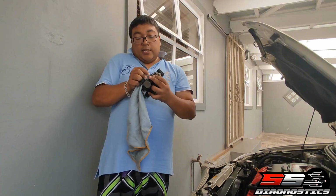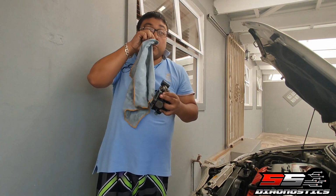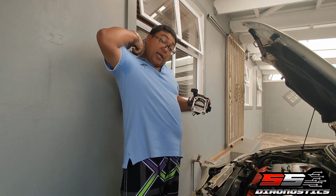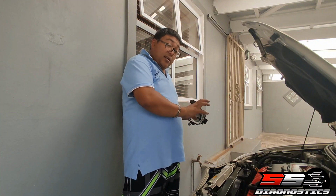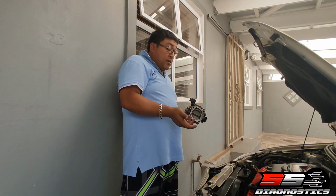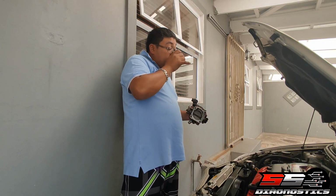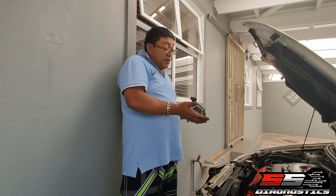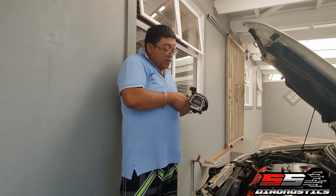So also, thermal gaskets basically help to keep the intake cool. You get a thermal gasket that goes against the cylinder head, and your intake goes onto the cylinder head, and then at the bottom of the plenum, which is like our cars in South Africa, the two-piece intake, you get the thermal gasket that goes there, and then you get the thermal gasket that goes here as well on top of this.